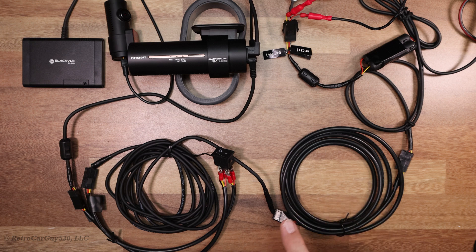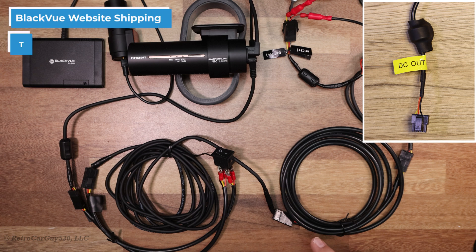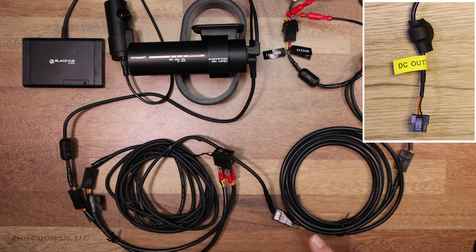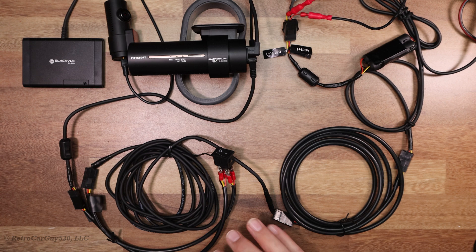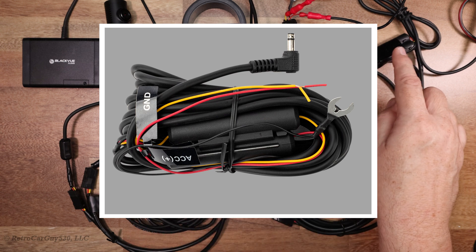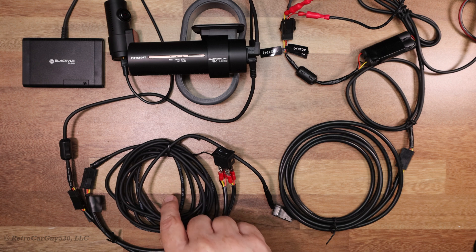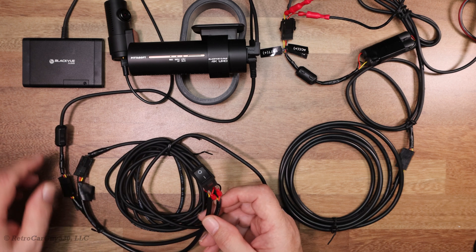Since I have a dash cam battery pack, I wanted to find a cable that BlackVue offers on their website to plug directly into it. I tried to order it but there were no available shipping options for my location in Northern California. So I proceeded by buying the necessary Molex connectors and terminal pins myself — information is in the description section. I also bought ferrite filters. I cut the end section of the 3-wire harness included in the dash cam battery pack box, added a 6-foot extension, then made an additional modification at the front of the cable by inserting the switch assembly using Molex connectors and adding another ferrite filter.